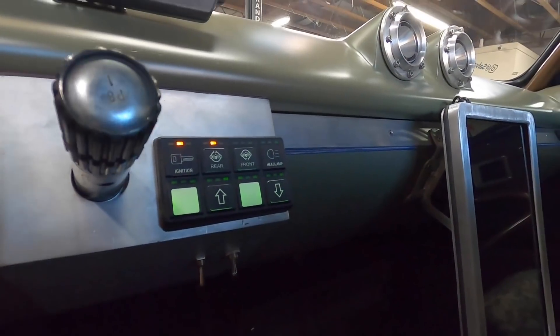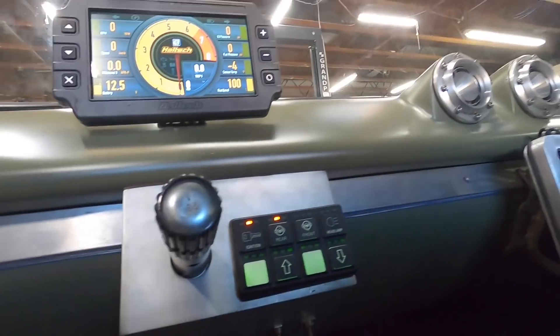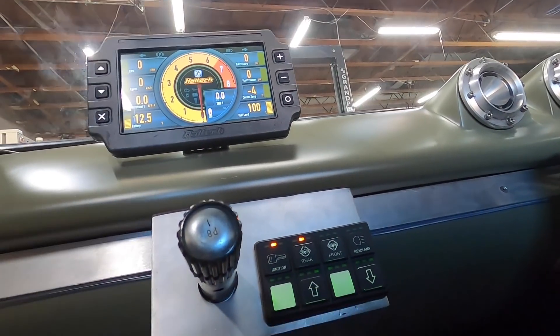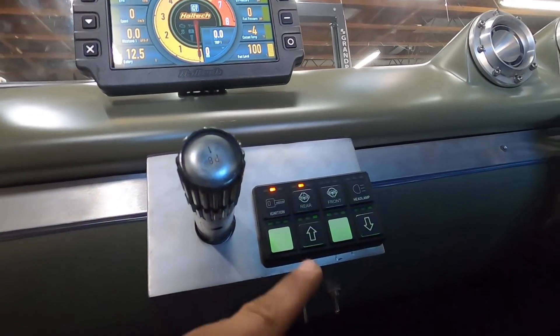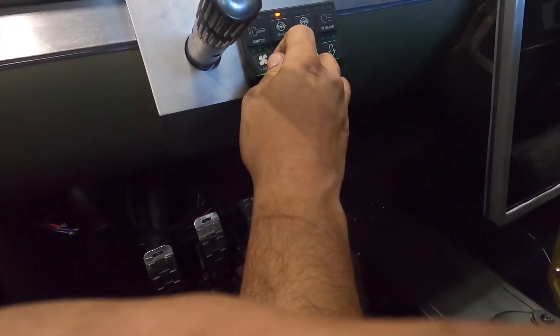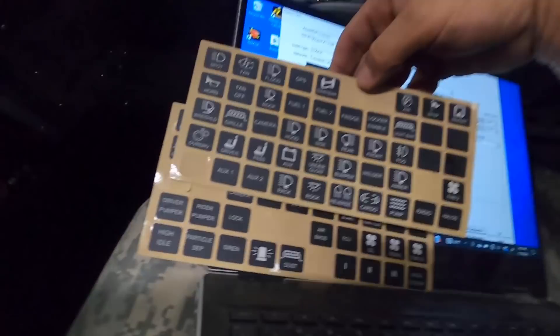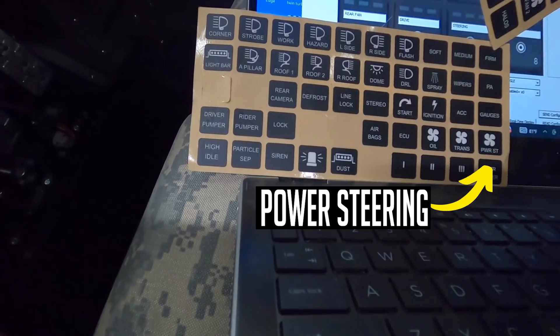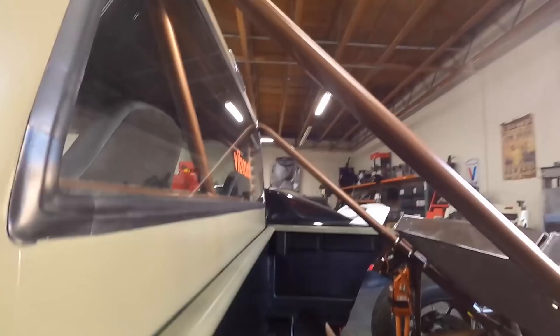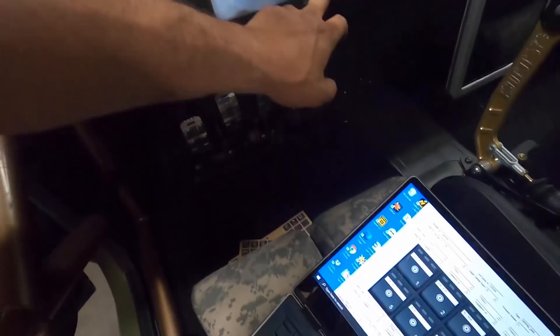Another quick thing — I haven't really allocated a switch to the power steering or the rear fans yet. With the rear motor on, you want to have the fans on. You want to have the pumps running for the coolant. But I wasn't sure if I wanted everything to come on as soon as I turned it on. So what I ended up doing is reprogramming some of the buttons. I'm going to use this first switch here to toggle our fans. I don't see anything for steering — I'll just remember steering. Reconfigured it, sent the messages. Now I should turn our fans on. And there's our pump. You can hear that annoyingly loud hydraulic pump.